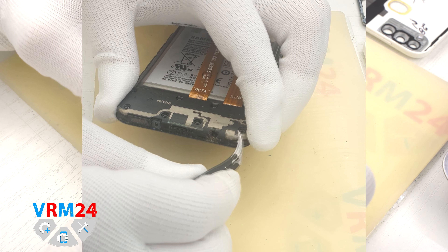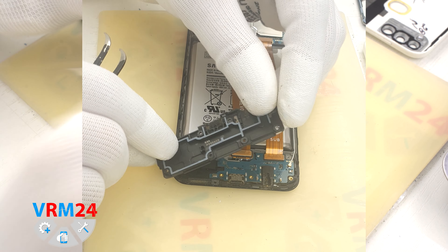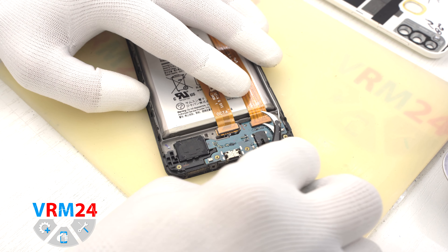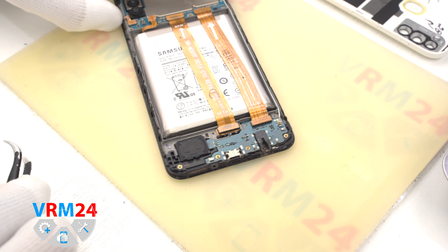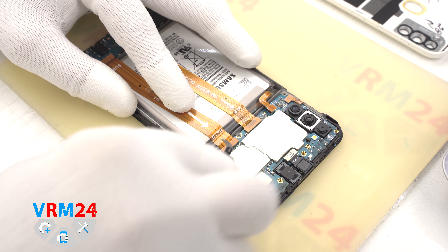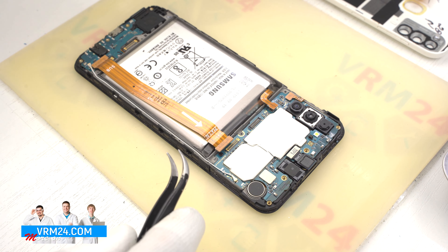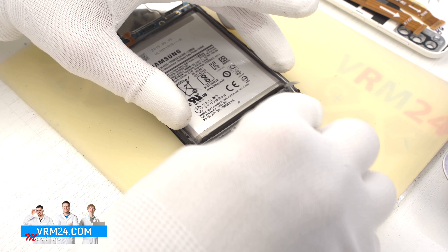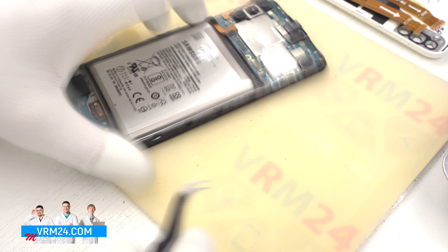Then we hook the cover by the edge and detach it. On the cover we have the transmission lines and pads for antennas. And we can disconnect the coaxial cable connector and the connectors of the two interboard cables on the subboard. After that we disconnect the connectors on the motherboard and put the interboard cables aside. The same way we disconnect the connectors and take out the coaxial cable and put it aside.